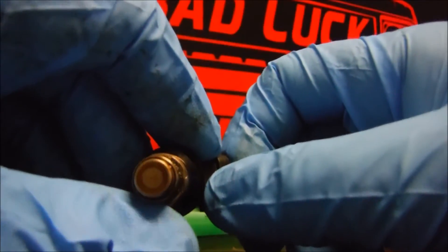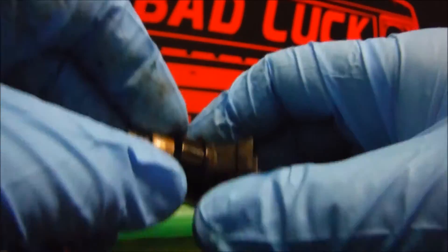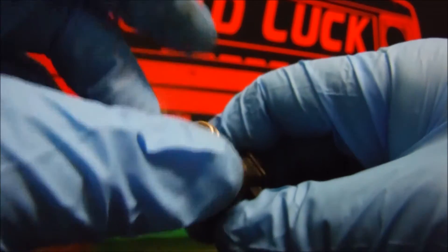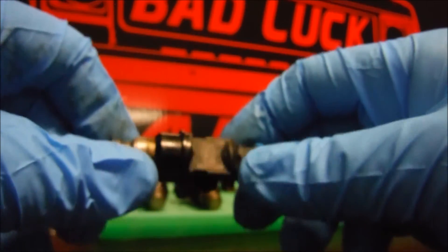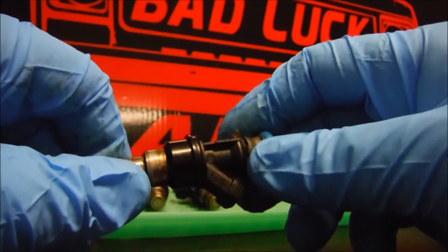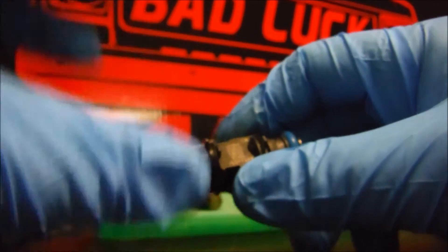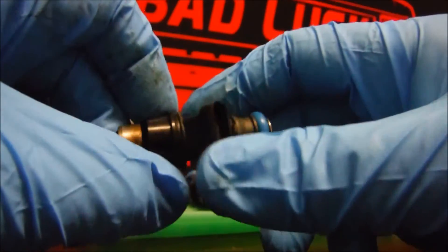It's basically two pencil sprays that slightly fan out a little bit. If it sprays for a foot it'll fan out some, but they're not spraying for a foot inside your engine anyway. Inside the engine these things are spraying for a couple inches. If you look up test videos of these truck injectors, look at the first two inches — you're basically getting two little streams, not an atomized fan spray. So I really wouldn't worry about that too much.